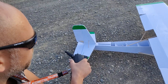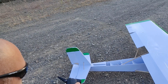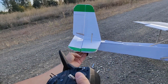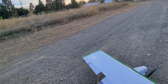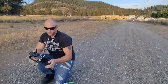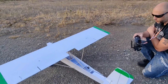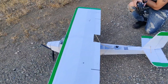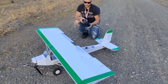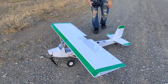If you see how much elevator I have to use to keep the nose up, I'm wondering if it's too nose heavy. That's a lot of elevator — I have it basically maxed out on the trim and I still had to hold it back a little bit. That either tells me it's too nose heavy or this wing isn't generating much lift, because as soon as I put on a bit of flap it just goes right up, and with full flaps it goes straight up — just a ton of lift.